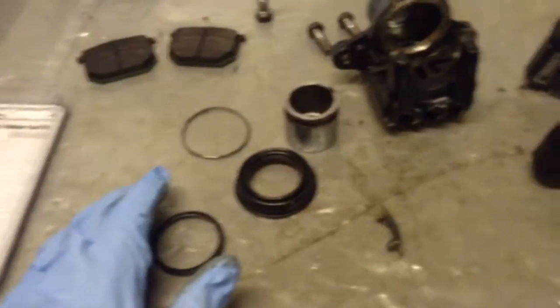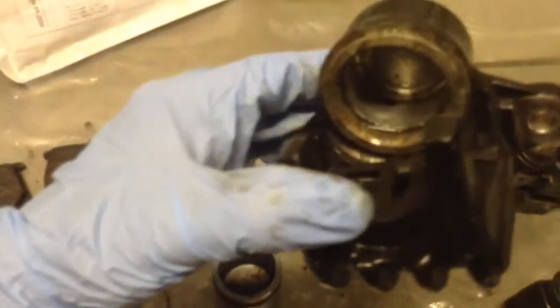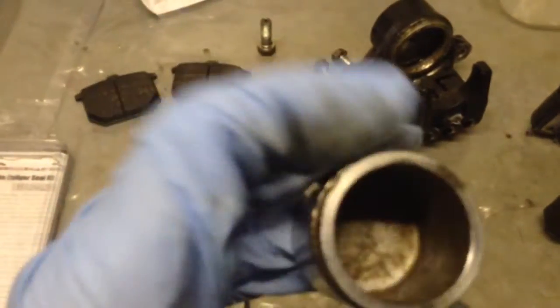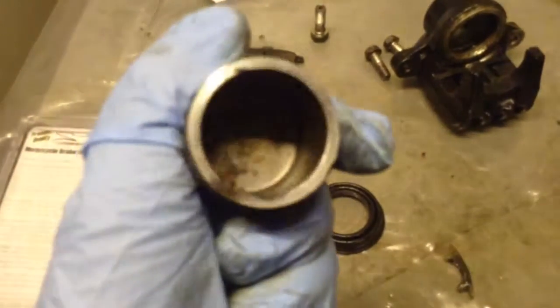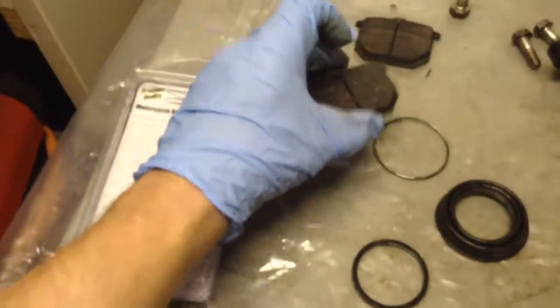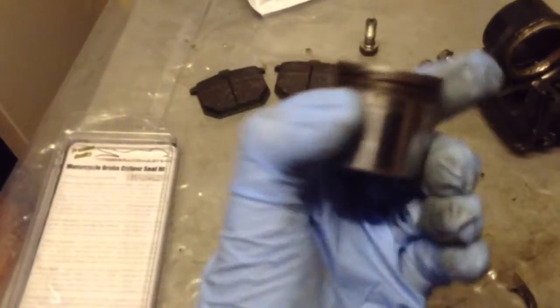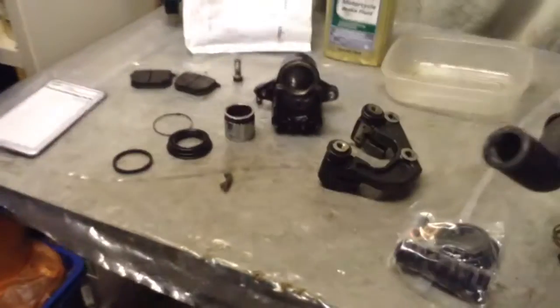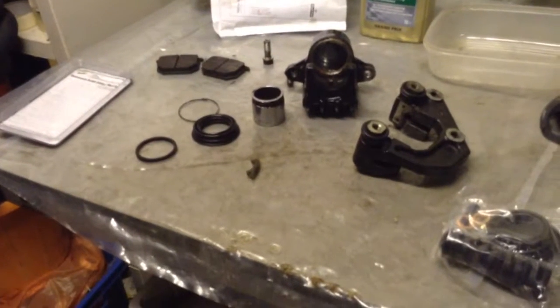All I need to do is clean all of this stuff up and get all of the gunk and rubbish out of there. Make it whistly clean and really clean the piston up and get all the gunk off there. It's the surface there that needs to be clean, really. There's no burrs or major issues — it's just 35 years old, I guess. These do need to be clean, otherwise they're just not going to operate properly. If you've got crap and gunk in there, that can stop the natural vacuum pulling that piston back in.